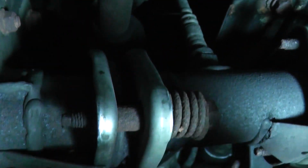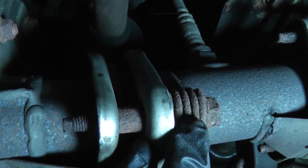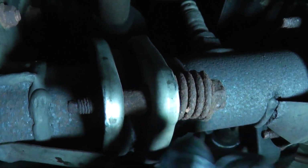They give you a nice wide separation between the flanges here where you could just get a grinding wheel in there and just cut that off. One thing to be aware of if you're going to cut these off, these are under spring tension. The instant you fully cut through this, this fastener will shoot off in that direction, so be careful.